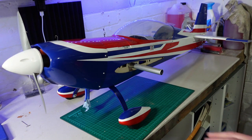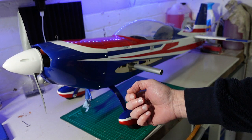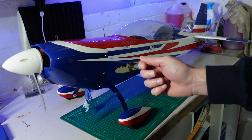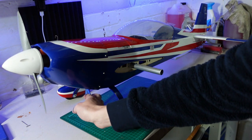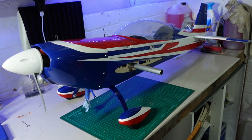I came in for a bit of a heavy landing so I bent the undercarriage a little bit, just got to take that off and straighten it up — that's not a biggie. I've also got to do a bit more plumbing. Normally I use Dubro Quick Fillers that connect to the tube going to the carb, but I've only got a filler tube and I've realized I actually need a T-piece going to the carb to allow me to drain the tank afterwards.